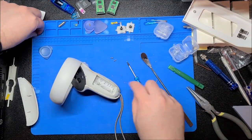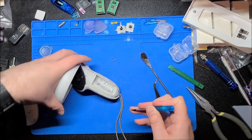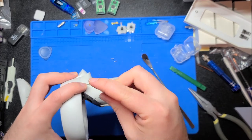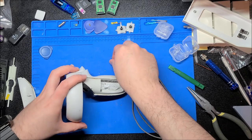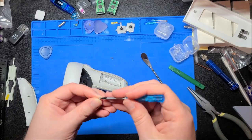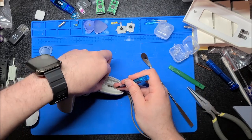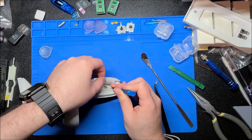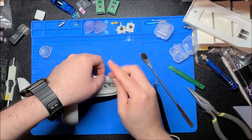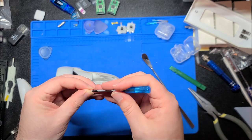Well, home free — I still have to actually test this. I have to pair this with my controller. It's a little annoying: apparently you need the Meta Quest app in order to pair new controllers, you can't just do it with the headset itself. I'll show you how to put the controller into pairing mode — you need to go into the app, into Settings, then Controllers, then Add New Controller or Pair New Controller.